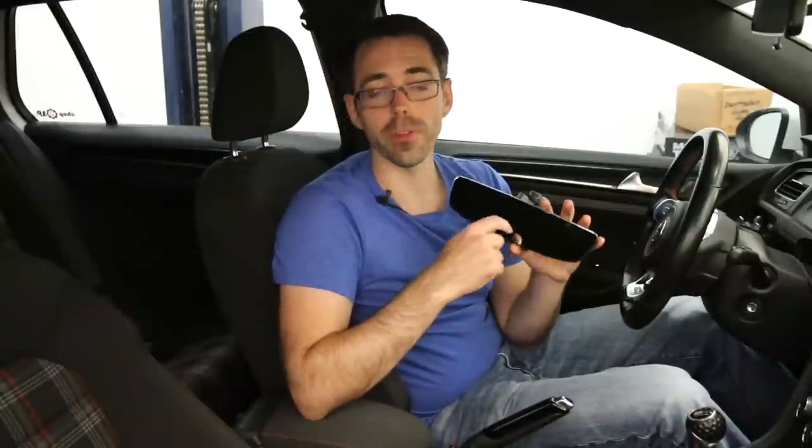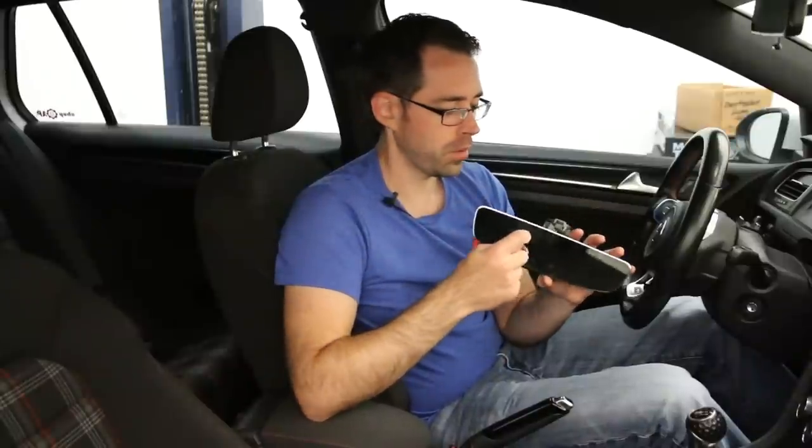Before we get into this install, let's talk briefly about this particular install. The install of the mirror itself is super simple. There are a couple variations of this mirror for Mark 7 cars. This also applies to a lot of other vehicles, so we'll try to link details in the description below. For Mark 7 models there are only two different variations: one for vehicles without a rain sensor, and another for vehicles with a rain sensor, because they use a different mount or base plate on the windshield.